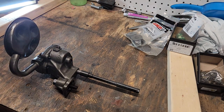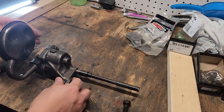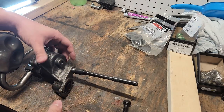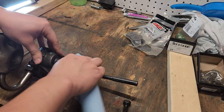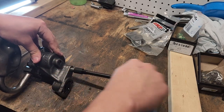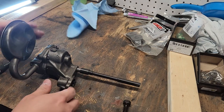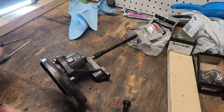Now we're going to work on getting the oil pump cleaned up and get that put back in. If you're not using a steel collar on your oil pump shaft, look into it — there are a lot of failures associated with those plastic shafts. You want the steel shaft for the steel collar. I can see some crud here in the pickups, let me see if I can get some of that out.